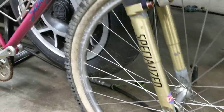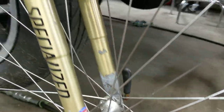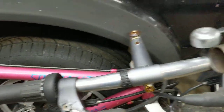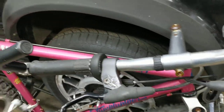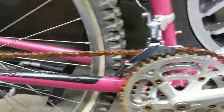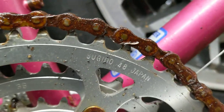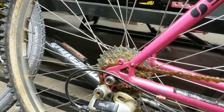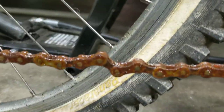The tires are Smoke and Dart, which is my favorite combination to ride until the Ritchey Z-Max came out. This thing's completely original, unfortunately the tires are severely dry rotted so I'll have to change those out. It's been left outside. Got some Onza bar ends, some early Grip Shift. This is all XT M732 with some Specialized cranks with Sugino rings. I'll pull this stuff off, get the fluid film off, and put it in the Evapo-Rust to see if I can get this chain functional. I've had pretty good results with Evapo-Rust.